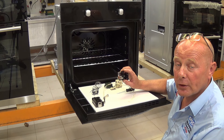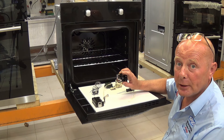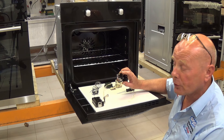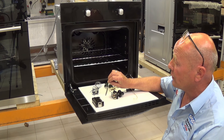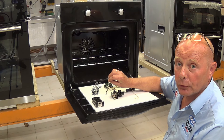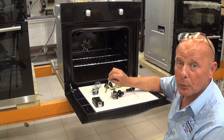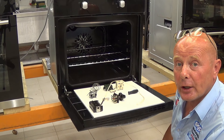Energy regulators can become open circuit and can also stop cycling the grill on and off — again meaning the grill may only work flat out without controlling temperature. On more modern cookers, NTC sensors can fail, and with circuit board types, relays are a common fault. Sometimes the circuit board itself may fail. I hope this gives you a good understanding of what can go wrong with your grill and how to diagnose the problem.